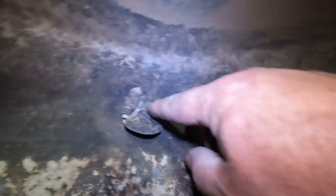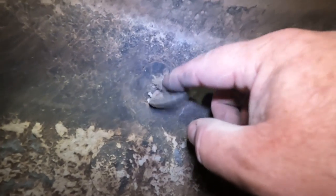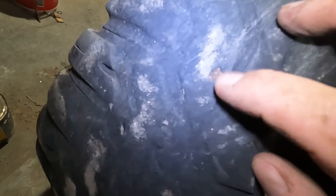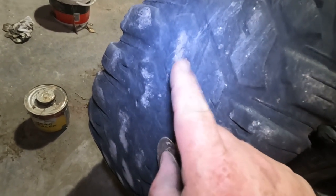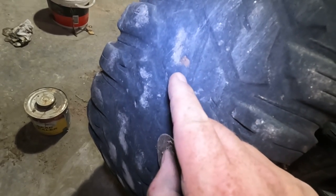Now this tire has a plug there, the good style. And this is a good style one too, but it looks like it's come off. Actually, no. What did they do? Yeah, I don't know. Let's look from the outside. It's a rope style one too. Looks like they had a good style patch on it. That started leaking, and they shoved it through while installing this one. So, let's assume that'll be fine too.